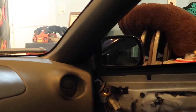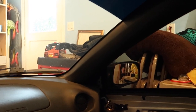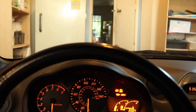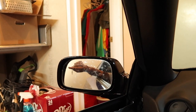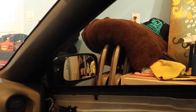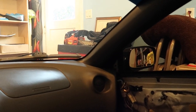So it's the next day. It got kind of dark last night, but as you can see I have both mirrors on and they're wired up. Let me just show you real quick. Right now they're closed — I'm just going to open them up. So the passenger side closes and opens a bit slower than the driver's side, but that's not the main issue. The main issue I'm having is — this is kind of the POV of me driving — when I look over to the mirror, this is as far as it goes, and I see a lot of my quarter panel and I can barely see anything towards that side. Same with the other side — this is as high as it goes. And it's slightly better but it's not how it's really supposed to be. But then again, these mirrors are from a right-hand drive car. So that is the issue.